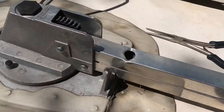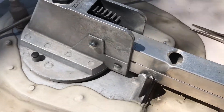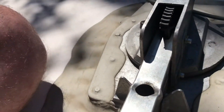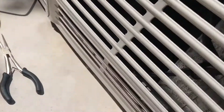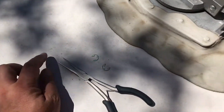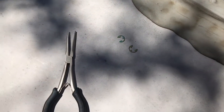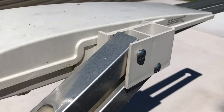Remove the antenna head and the arms from the base. It has these two little snap clips on the end — just need to pop those off, same on both sides, there's four of them. The clips are off. All I did there was take the needle nose pliers, stick them in, pry them apart a little bit, and then they pop off.